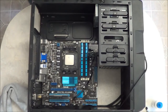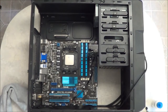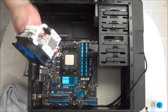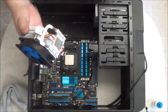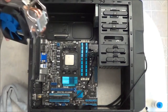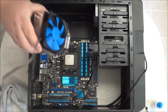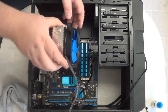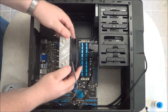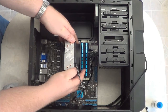In this case we're working with an AMD processor. If yours is Intel, it'll be similar but will probably have screws to bolt it down. I've already assembled the heat sink — if you need to assemble yours, follow the included instructions. Once the processor surface is clean, you want to line up the heat sink with the processor. This one does have some heat sink compound on it already. It may take two hands, especially with AMD processors — gently line it up.